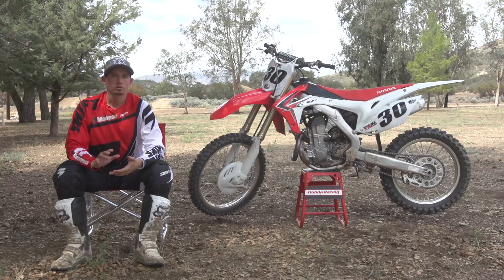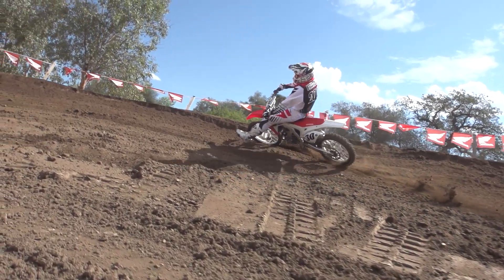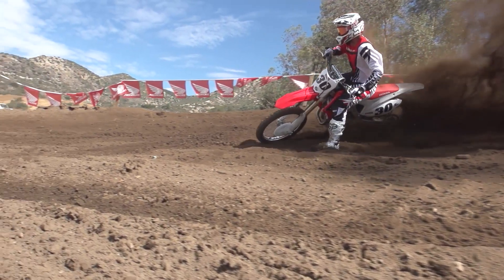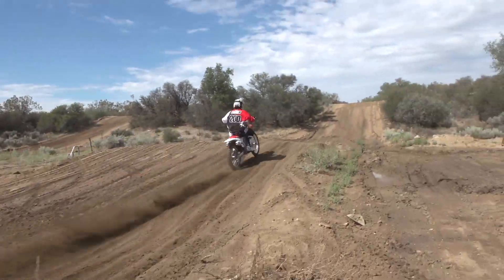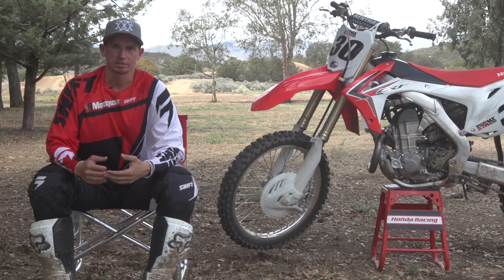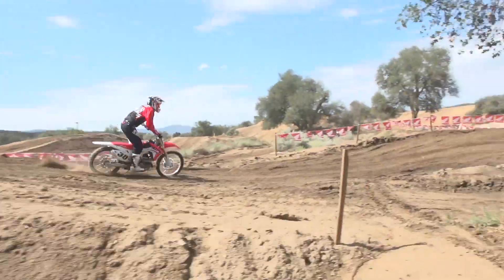They made it a little bit more substantial at the initial stroke, so the bike just feels like it rides up in the stroke a little bit higher, which ultimately gives it a smoother ride, a little bit more predictable, especially entering corners. The front end's a little bit more stable, but the middle of the stroke is where it gets progressively stronger, and it just doesn't blow through the stroke nearly as much. I think they moved the stock air pressure up a couple of pounds and adjusted the valving accordingly. I would describe the action as the fork holding its integrity a lot better — it's a lot more consistent. Coming into corners hitting the braking bumps, it doesn't want to blow through the stroke as much. It feels smooth, and ultimately it's much more predictable than last year.